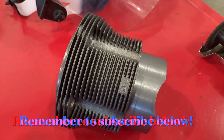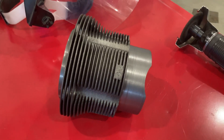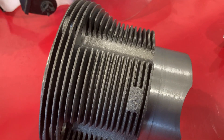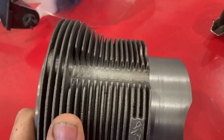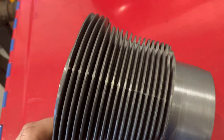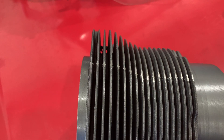Hey everybody, I am working on some AA cylinders today. These are going on a 412 car, an engine I'm building for a customer. They had bought these pistons — 96s that slip into a 1800cc Type 4 case — but I want to talk about some issues I see with AA cylinders. It seems to be compounding with time, and you can see some of the flashing in there, which is what we're going to be talking about.